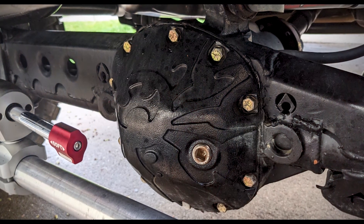I've only seen one or two instances where they didn't have clearance — one was on an LJ where, after a high steer kit and new suspension, we did eventually get clearance. By and large it'll fit just about every application. As for knowing what axle you have: sport and Sahara Wranglers have a Dana 30 front and Dana 44 rear; Rubicons have Dana 44 front and rear; Gladiators are Dana 44 both front and rear. So Daniel, short answer — yes, the Dana 44 covers will fit.